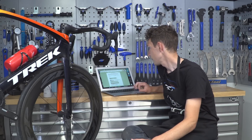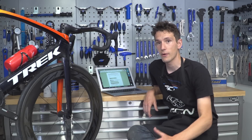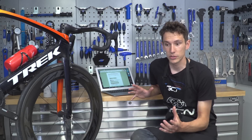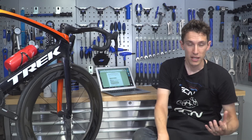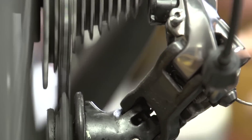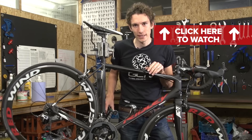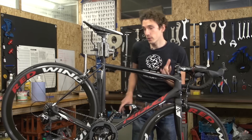Next up we've got this one from Patrick Joseph. Almost every bike shop tells you to bring your new bike back after a few weeks to retune the gearing — is that just an excuse to sell you more stuff? No, it's definitely not. Cables — we say that they stretch, but the cables themselves don't stretch. All the housing and stuff can compress down, and that can make your gears just a little bit out of tune. All the bike shop needs to do is tweak the barrel adjuster, but it's definitely something you can do at home too. If your derailleur doesn't sit exactly beneath each cog in turn when you're changing gear, then the gears are not indexed, and they're going to be working badly. It's the process of indexing that corrects that, and you can micro-adjust it very simply.